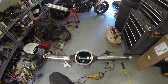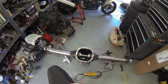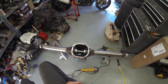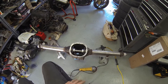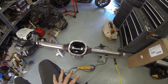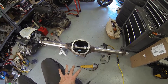Even though all the magazines and websites seem to recommend going elsewhere, they're always talking about getting Dana 44s out of different vehicles, which are generally much wider track — and that isn't always good for a daily driver. For trail use it's fine, but for a direct swap this axle is about as close a width as you want — I think it's within 3/8 or 5/8 of an inch narrower than a factory TJ axle.